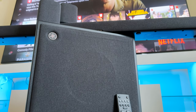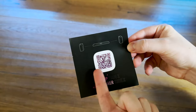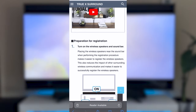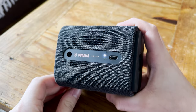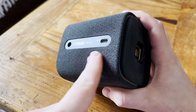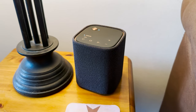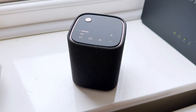At this point I was prompted to update the soundbar's firmware which did take an additional 2 minutes. With all of that connected and ready to go, let's add the portable wireless speakers into the mix. You can scan the QR code to go directly to a simple guide, but the process is also very straightforward. Turn both of the speakers on with the power button, then hold the circle or mode button down for 3 seconds. This will allow you to choose either left or right, indicated by a light on the back of the speaker. You can swap between left and right by single pressing the mode button. Once you've got the speaker in your desired setting, hold down the mode button again for 3 seconds to activate pairing mode. Then press and hold the setup button on the remote for 3 seconds and you should be good to go. Repeat this step for the second speaker and you'll be ready to enjoy some incredible sound.